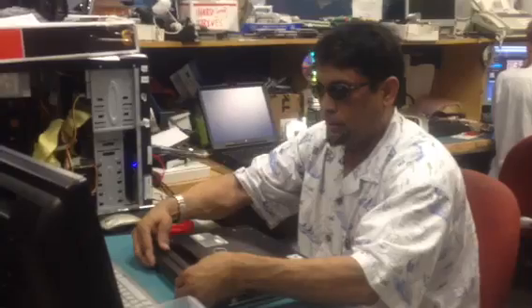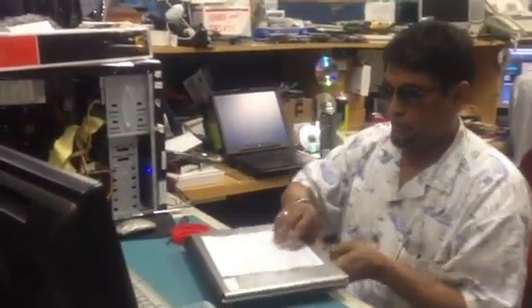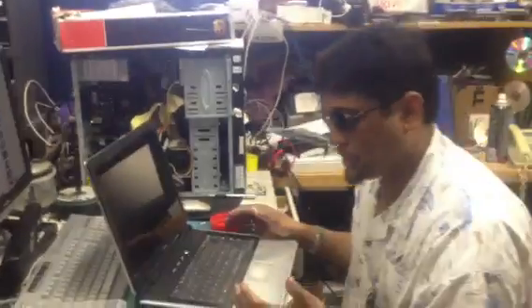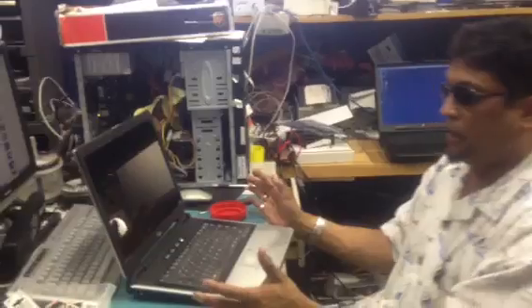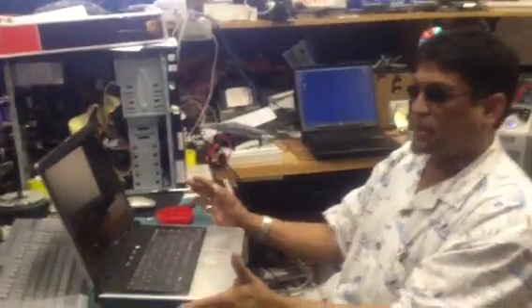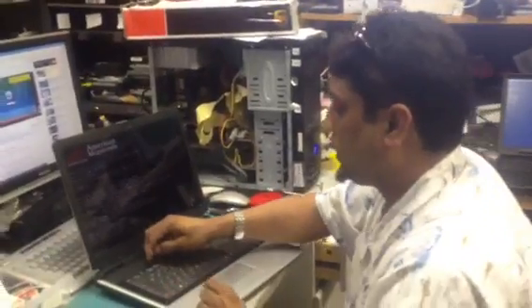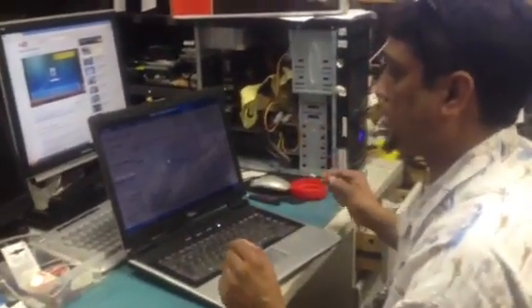Turn it on. I'm about to put the battery back on here, turn it on, and close it. I'm about to turn on this laptop. Since we changed the CMOS battery, the date and time will be reset. We go first to whatever operating system — in this case, BIOS says F2 to run setup, so we're about to run F2.